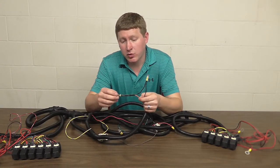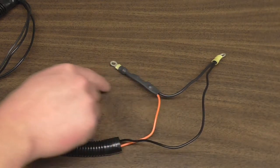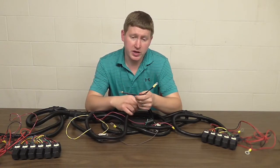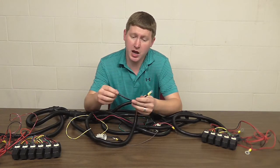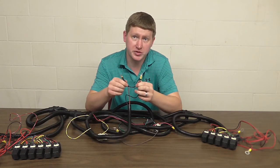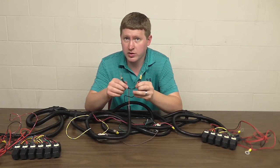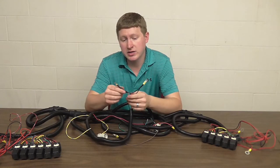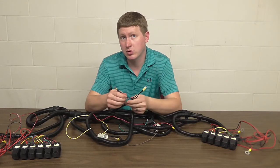The diode is installed with the white stripe facing towards the ring terminal with the orange wire. One other thing to note about the solenoid is with those two little posts, there is no polarity, so it does not matter which one of these two ring terminals you hook up to which post. I would not recommend putting anything else on these two posts because the ground and the power is going to see voltage spikes, which could throw off your reference ground if you're attaching to the black wire.